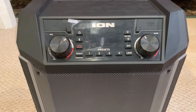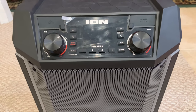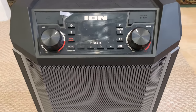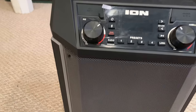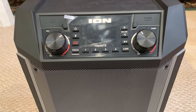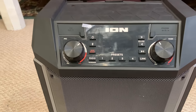One of the major complaints people have about these ION speakers is that units are advertised with 50 or 100 hours of battery life, but fairly quickly these batteries don't seem to hold up to their original promise. Part of the reason is that people don't realize it's not a lithium-ion battery in these units — it's actually a lead acid battery, basically your automobile-style battery.